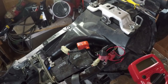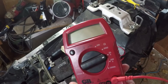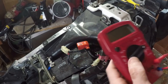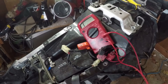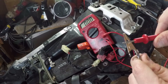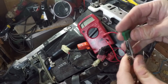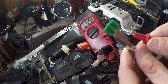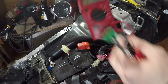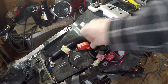Now if you're not positive whether your fuse is bad or good, you can just take your multimeter and set it to read ohms. This is a shitty one — some people are fortunate enough to have a good one that does a beep test. I stick these together, it goes to zero, so there's a connection. Stick that to one side — that's a good fuse. Put that back in there. That's one problem eliminated.